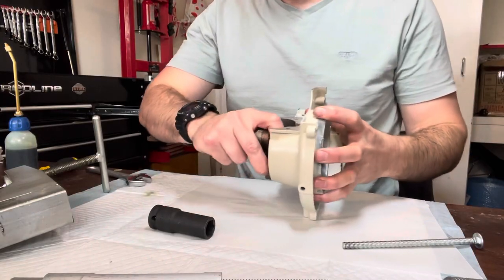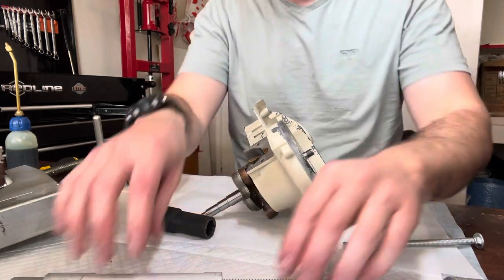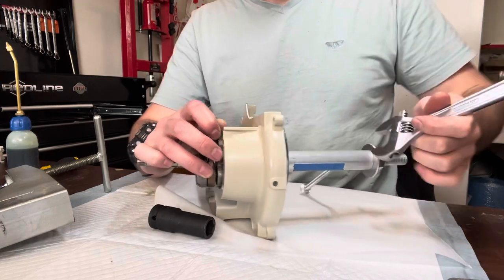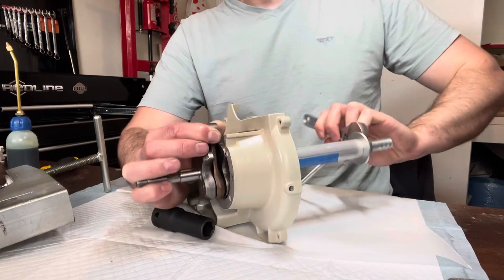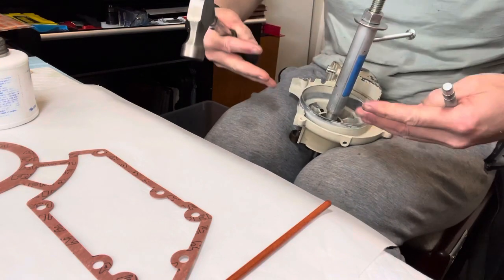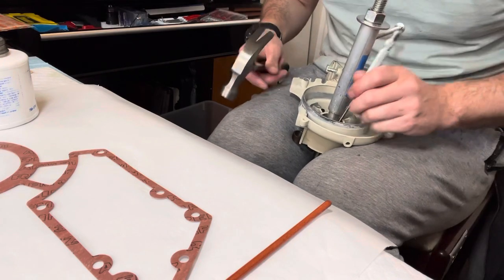The next stage: I've slipped the crank in partway to put it inside the bearing — you can use heat again if you want, but I've got crank tools. These old saws are delightful in that they're not super tight so everything slides through easily. I'm going to tap the positioning pins home first and the gasket can rest against those. If the pins are out too far they cause friction and you have to put a lot more force on pulling the crank through, whereas if they're just above the gasket they align everything nicely without creating friction.